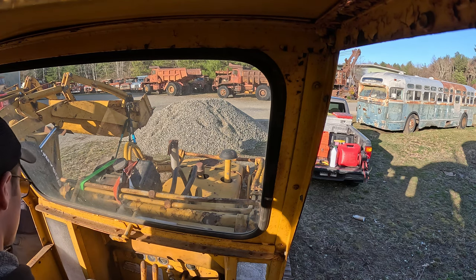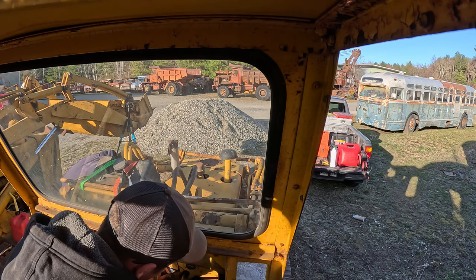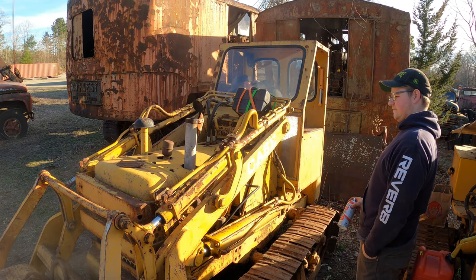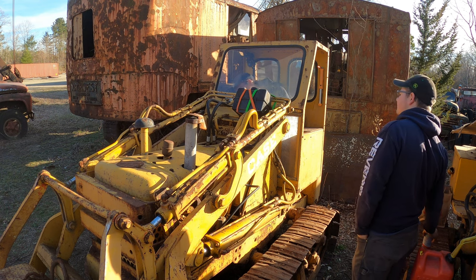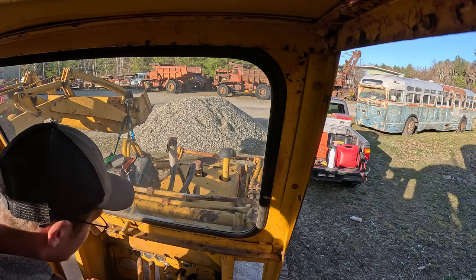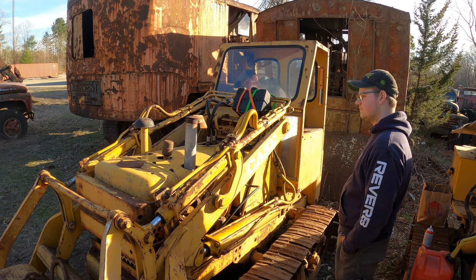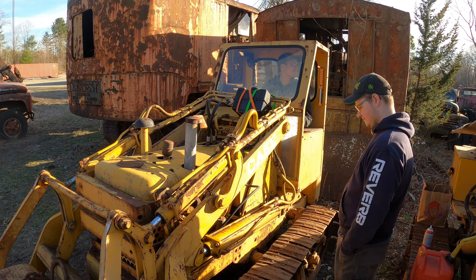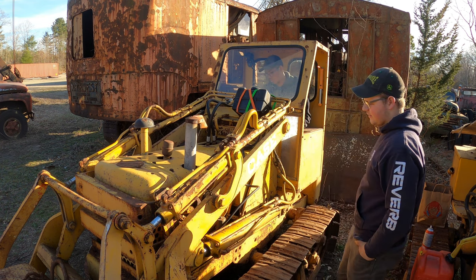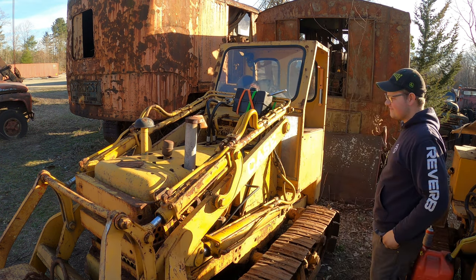Alright, let's try it again. Starting fluid. Give it one click of gas, throttle. Are you ready? Yep. Can we spray it? Yep. Got it. That was running. It was idling and I moved it. That's a lot better. I think it'll start right up, Ben. Though it didn't want the throttle. Don't give it choke. No, don't give it throttle. Yeah, I'm not giving it throttle. That turned it off. Worked exactly like Grandpa said. Pull the choke out, push it back in, and it'll start right up.